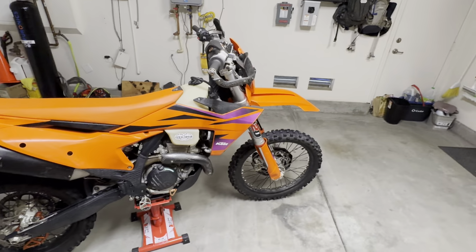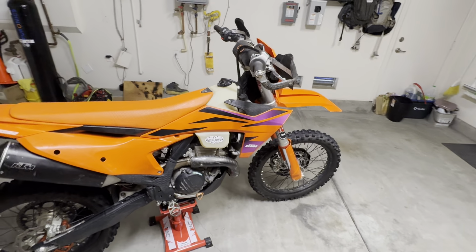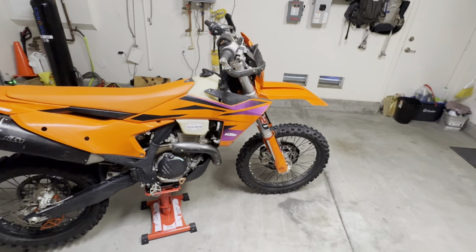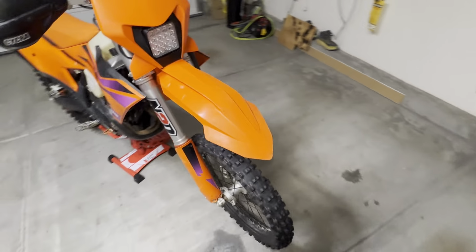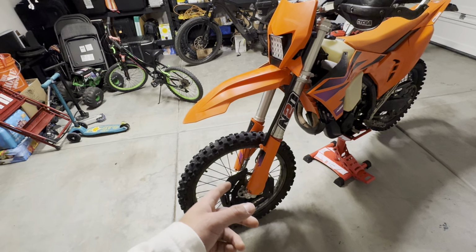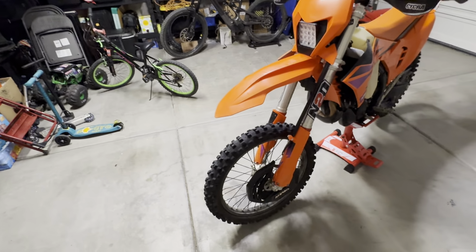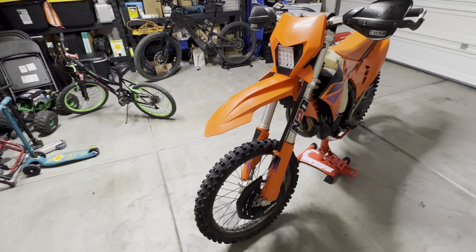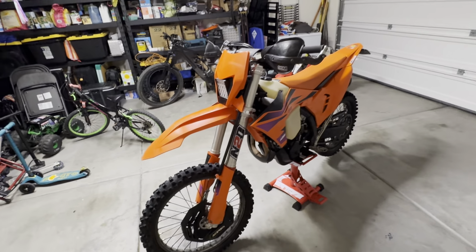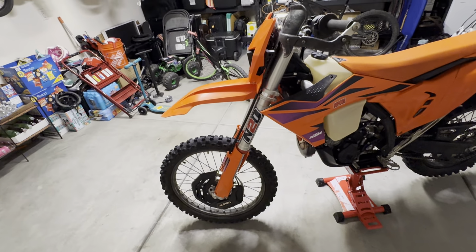I just went with the full rebuild because I had a ride or two. We got a ton of rain, so I think I got dirt in the forks and I blew the seals. They were leaking all over the place, and I ended up changing the front brake pad and the rotor too, because they got soaked with oil. And the owner of N2D was like, dude, this is not safe. I mean, they were squealing pretty hard. He said they'll never be the same, so you should swap them. I was like, fudge. Extra like $200, but it is what it is.